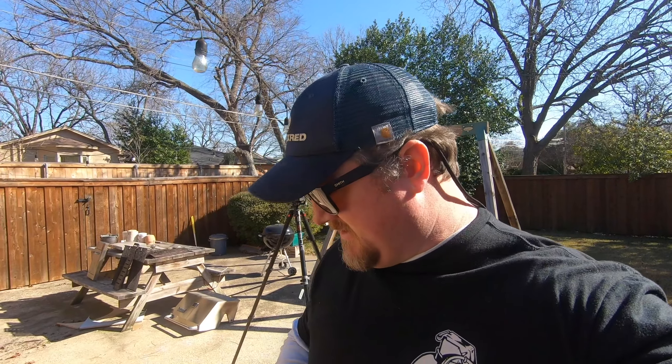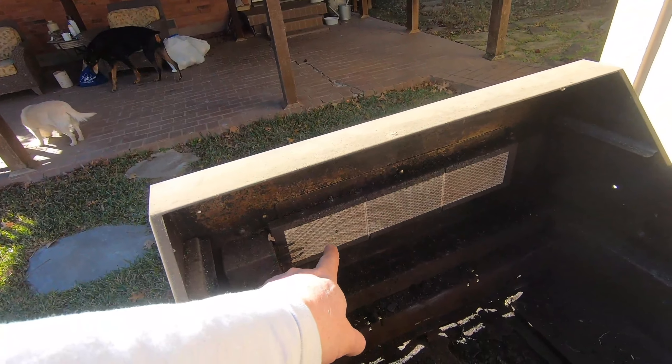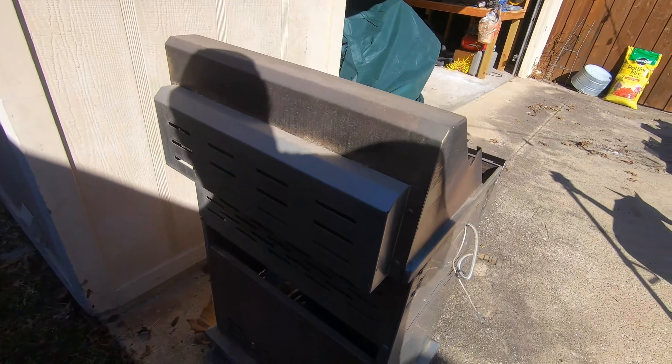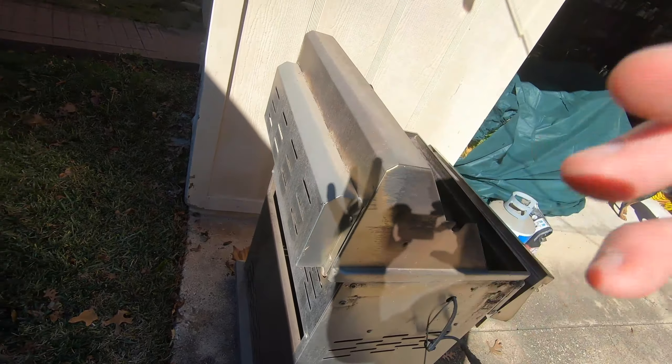I did miss one part on the back — it looks like it's some sort of heat cover for the actual rotisserie heating element that sits on the inside. You have the heating rotisserie element right here and I'm going to take off this cover right here, it's just four screws. Really simple. We'll take those off. And then of course I'm going to have to shop-vac the interior out, get a wire brush, hit it with some degreaser, get the whole thing cleaned up. I think I'm going to leave this for now and let's go look at the pieces we pulled off already — let's start degreasing those and see what they actually look like.